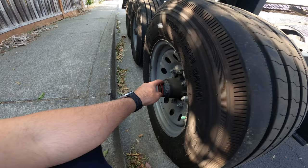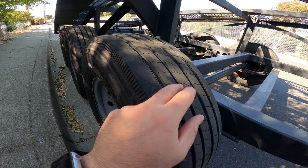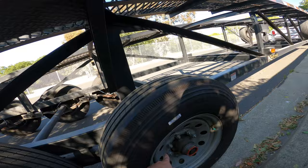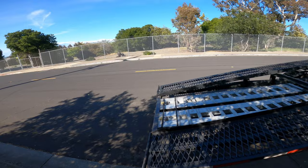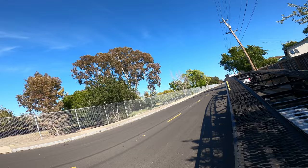Trailer lug nuts: same as discussed in the front. Tire tread depth: no less than 2/32 inch in the rear — you can have mismatched tires in the back. Valve stem: 'this is how I'll check tire pressure — it ranges from 80 PSI to 130 PSI.' Brake hub, seal oil, axle, U-bolt, leaf spring, equalizers, lug nuts, rim, valve stem — just like in the front. Electrical brakes: make sure you mention these are electrical brakes. Reflector lights are red in the rear, brake lights are working, license plate light is working, reflector lights are working, not cracked, damaged, or broken, DOT stickers are present. You're done.